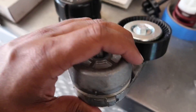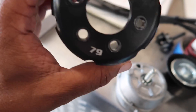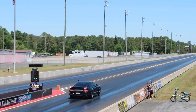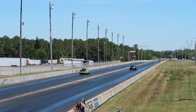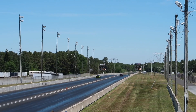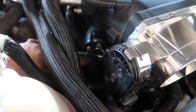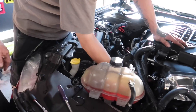This right here is the stock tensioner that was removed. And this big old — this is like a wagon wheel — just kidding. This is the 79mm that we did 9.4 on. We're going from a 79 to a 72mm pulley, so we're going to go from 15 pounds to 18 pounds of boost.